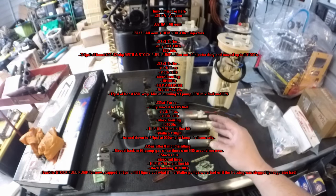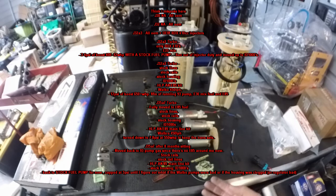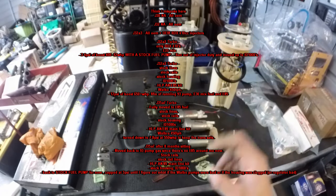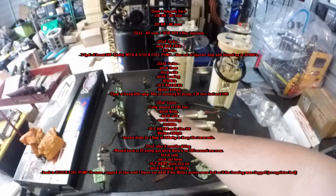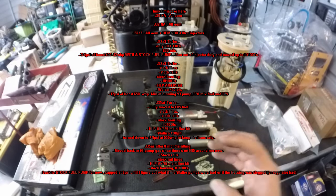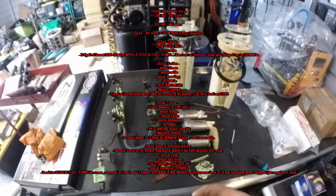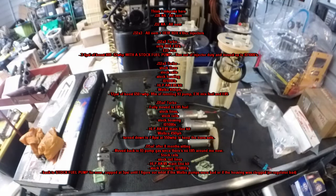If you have the 310cc injectors that came with the TL Type-S or the 3.5-liter engines, they'll handle more. I actually had RDX 410 injectors and went turbo with the J32 up to 400 wheel horsepower on an E35 mix — 35% ethanol, the rest regular gas. Literally everything was stock except the 410 injectors from the RDX, making 400 wheel horsepower on E35 while running three and a half to four pounds of boost on the J32 A3.